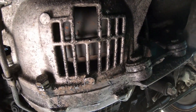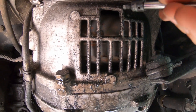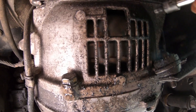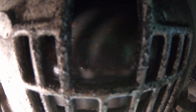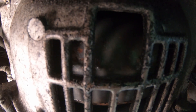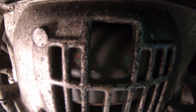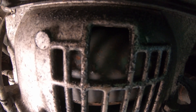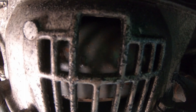Also, if you look up here, this little cover — notice how this has an opening because there's a drain plug. What we're going to do is look up in there and rotate our engine until the drain plug lines up with this hole. So let me leave you down here on the camera and I'll turn it to the right place.